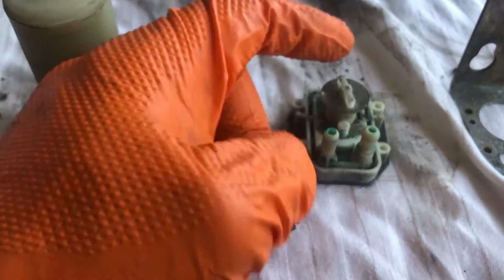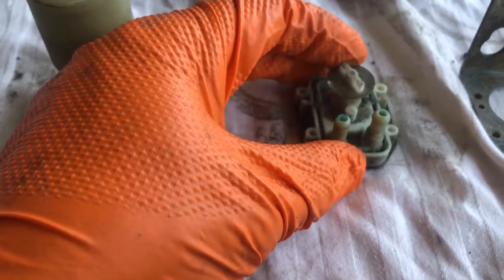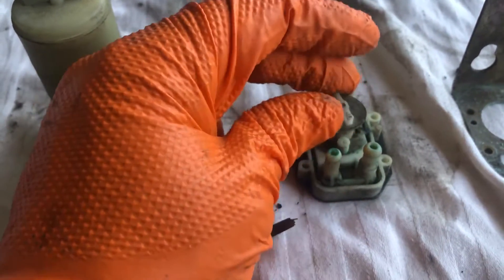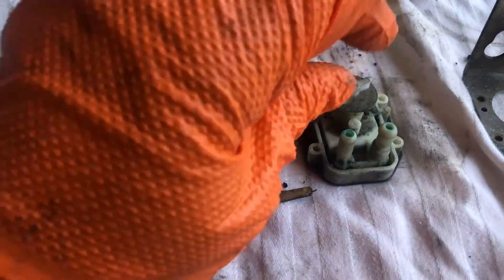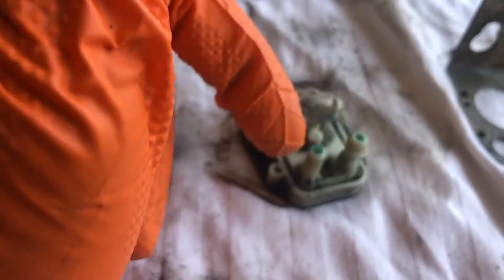The issue lies in the passageway between the inlet and outlet — it gets gunked up inside and then this piece is stuck or seized. I broke it loose just wiggling it with my fingers, which are a lot stronger than a small pump. Once I broke that loose I sprayed a little lubricant in here — maybe oil or white silicone. Spinning it one way you'll see water coming out of one side; spin it the other way and you'll see water coming out the other end.